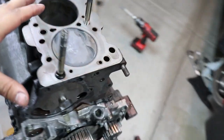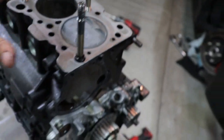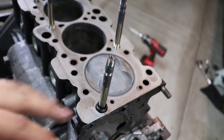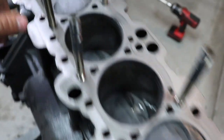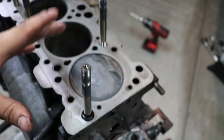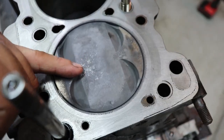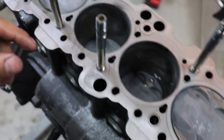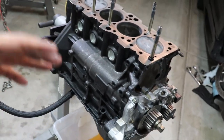We finally got the cylinder head off. These are the L19 ARP head studs, which did a great job holding the gasket down — it was a Fel-Pro Perma-Torque. I had no overheating conditions, nor did I have any boost leaking past the cylinders. You can see by the top of the Wiseco HD pistons there's a little bit of pre-detonation, which is concerning since we didn't see any knock on the ECM Link, but it's definitely there. The pistons themselves look in really good shape. Let's take off the oil pan, then the pump, and then actually take the rods and bearings out.